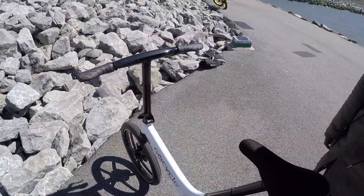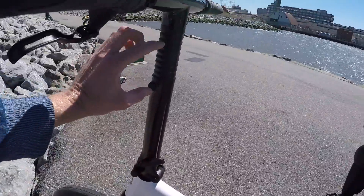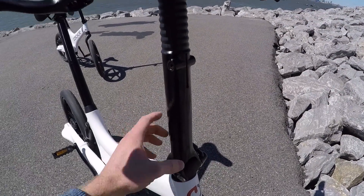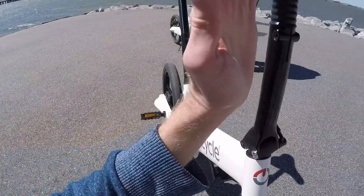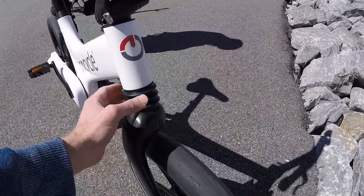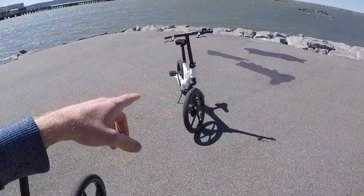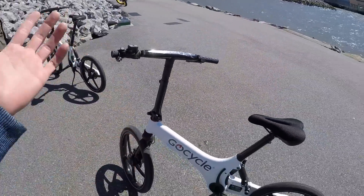I like the little upgrades they've done — the touch points, these ergonomic grips feel really good. There's a quick release up here and the stem can go up and down; see where this rubber cuff is? This isn't suspension — it's so you can slide it up and down for reach. You can also angle the stem forward or back for more or less reach. They've also flipped the headset so the adjustments are down here versus being up top and hard to reach on the older model.